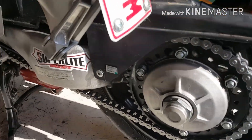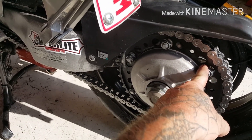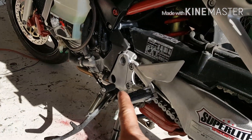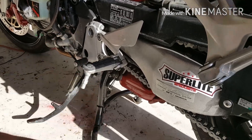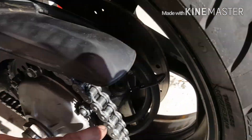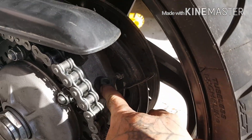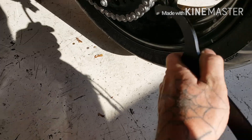We're all back together. These rear bolts are nuts — they're going to be 47 foot-pounds. The front nuts are 37 foot-pounds. Tighten your chain — I lift my back wheel up, tighten the chain, loosen this bolt right here. Take your wrench, stick it back up in there — going down loosens it, going up tightens it.